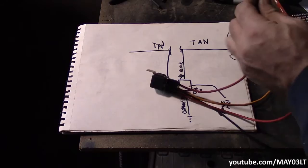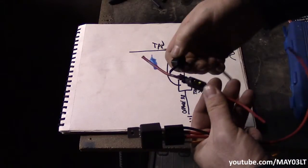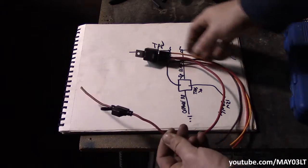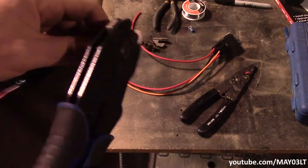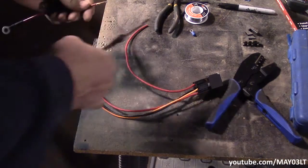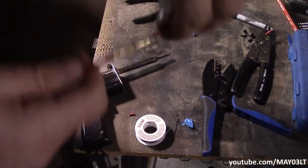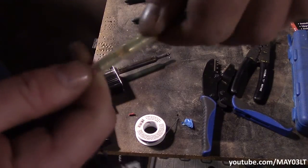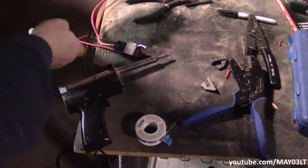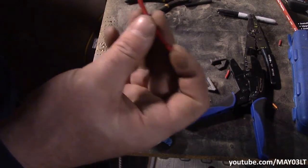Since pin 30 is going to be hooked up to the fuse box, I'm putting a fuse inline with it. I have a little add-a-tap fuse - I'll leave the wire a little long just in case I run into a problem. The crimps are on there. Since this is now going to be powering the low beams, I can't take the chance of a solder joint getting hot, working loose, and losing low beams altogether. The tan wire on the dash side is going to go to black, and the tan wire from the headlight side goes to the heavy gauge red.